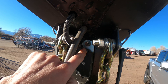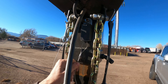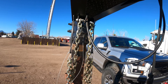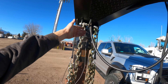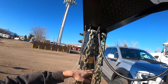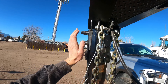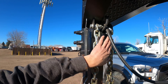For the breakaway switch, I just welded a stud — actually a bolt with the head welded to the coupler — and it's oriented in a direction conducive to being pulled out, as opposed to 180 degrees from there where it would try to rip the bracket off before it easily pulls the pin out. Keep this pointed toward the tow vehicle as best you can. I could have put it on the side here, but I thought this was the best spot — kind of protected from wind, rain, hail, rocks back here, but still pointing somewhat in the direction of the tow vehicle.